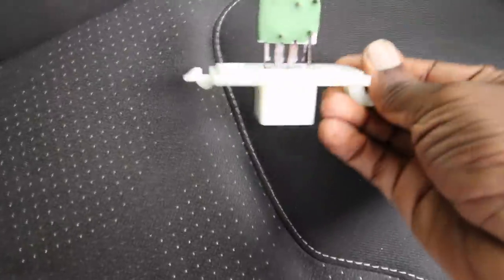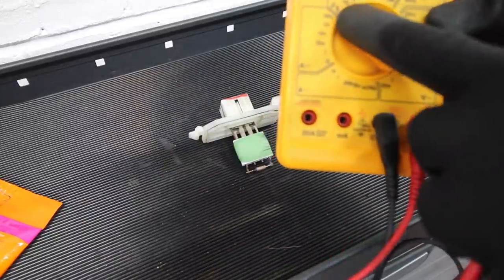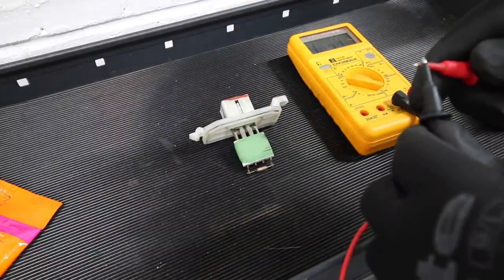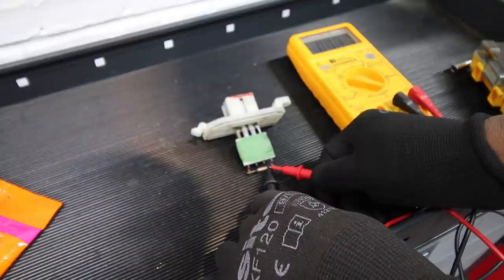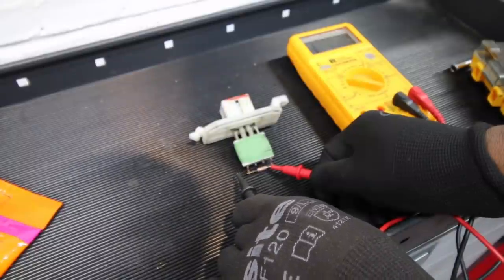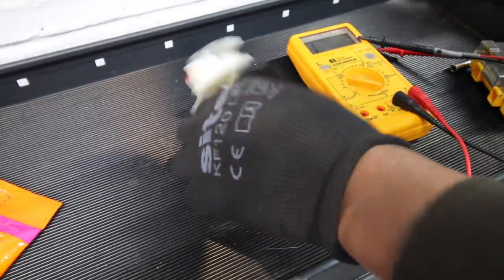This is the little resistor that breaks — this is what causes the fan to only work in one speed. There is an easy test you can do to see if it's working. You get yourself a multimeter, set it to continuity test. You put the two probes across the resistor — if there's nothing, you know it's gone. If I put the probes on this side you can hear a sound, but on that side there's nothing. That's why the fan isn't working on speeds one, two, and three — this is blown.